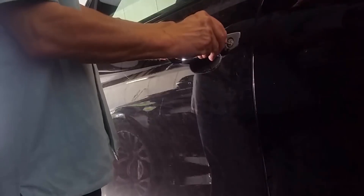Look beneath the cover for a slot as seen here. Slide the mechanical key in as far up as it will go and pull the cover away from the car, exposing the keyhole. Insert the mechanical key in the now visible keyhole and turn and you're in.